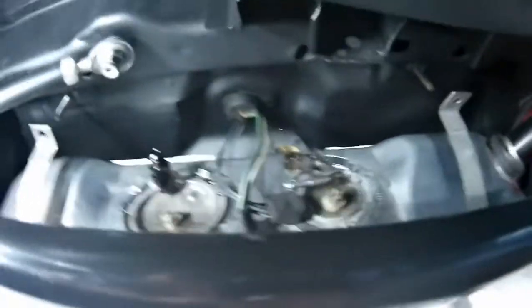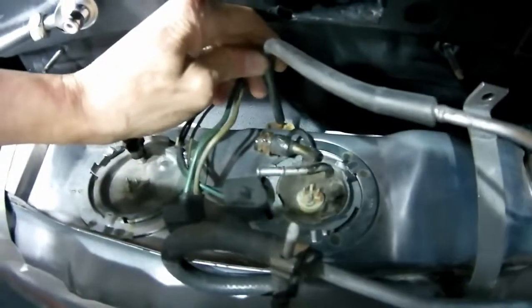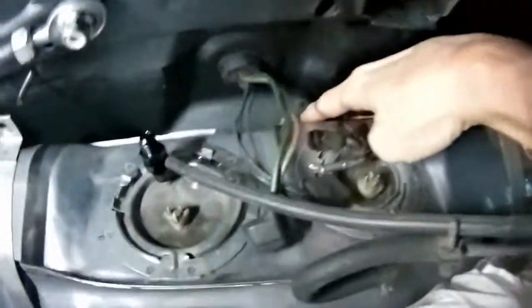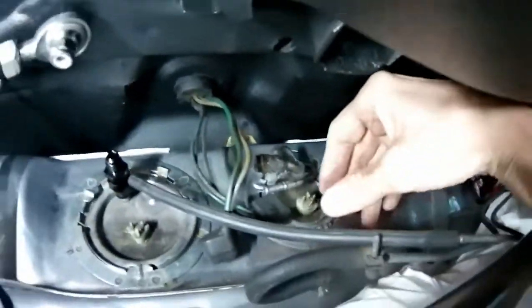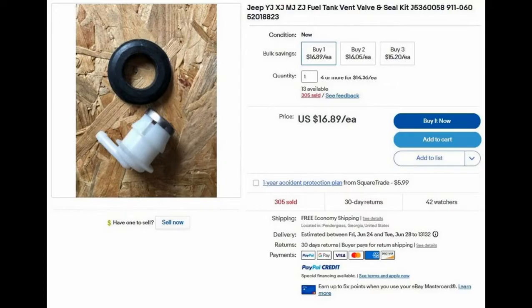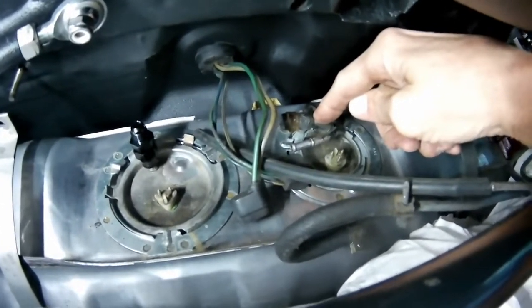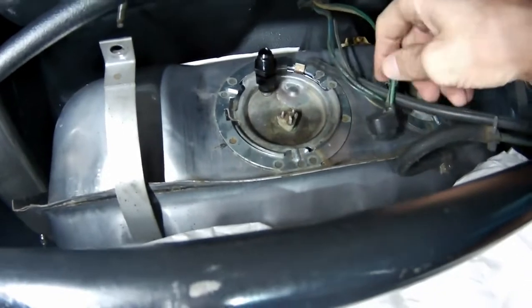It's crucial that you don't forget this because I did — your vent line needs to plug in up at the top. You've got your rollover valve, and if you need to replace a rollover valve, there's a comparable one from Jeep that will go right in. It comes with the grommet. So your vent goes on, your return. This is a drain valve — if you've got to drain your tank and you can't take the tank down, you can suck it out right there. And then the output of the fuel pump is here. And of course your wires.